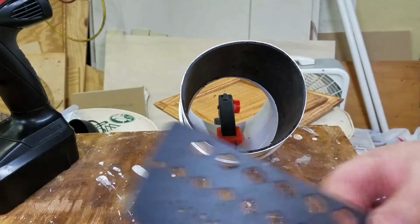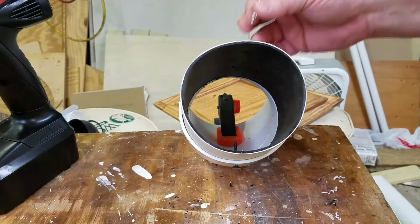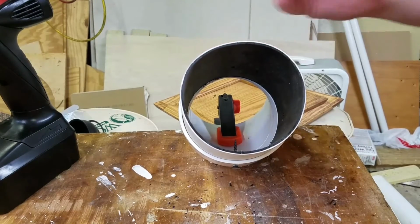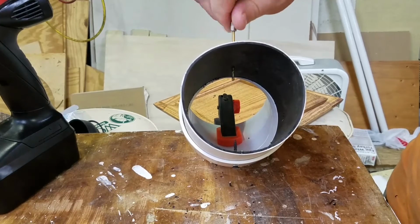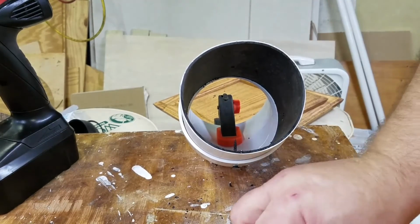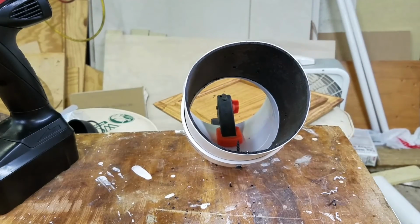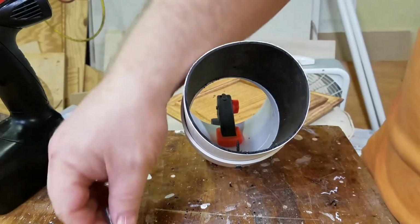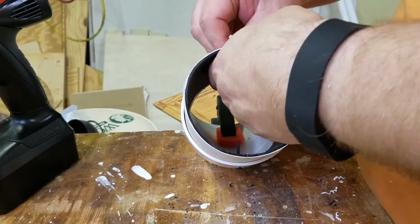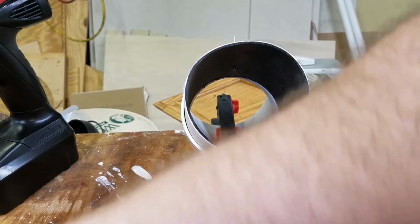Now we've got the holes in there. We've got our sizing guide. And it's 7/64. First things first, we check. And the hole's just a hair smaller. So let's go ahead and open that hole up to 7/64. Let's go just a hair bigger. Next size up is 1/8. There we go. And you can see that the rivet's in.